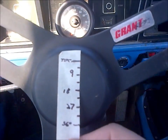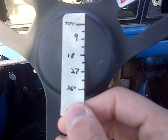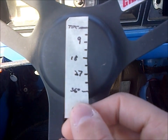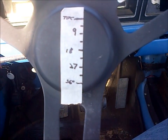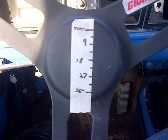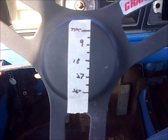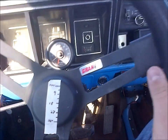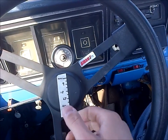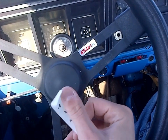You'll take this tape and stick it on your balancer, then use a standard timing light — they cost about $15 on eBay for an acceptable one. You can go ahead and check and set the timing on whatever vehicle you're working on. That's how to do it — I wanted to mention it because I use this trick a lot.